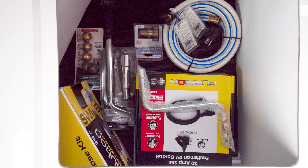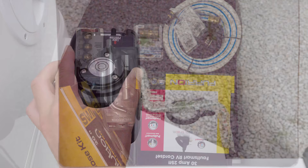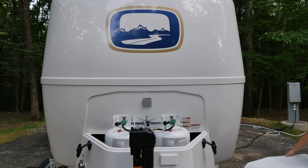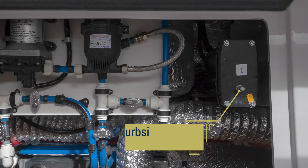In the case you do not have power from your batteries to operate the electric jack stabilization system, each of the three jacks can be controlled manually using the emergency jack crank located in either the closet or dry storage compartment. On the front jack, you will need to remove the leveling bubble by twisting and pulling up — be careful not to pull the wiring loose that is connected. Before manually cranking the jack, you will need to remove the propane housing lid to allow enough clearance for the crank to rotate. Then simply place the crank over the jack lug located on the top of the jack and turn until the jack is lowered enough to stabilize the travel trailer.